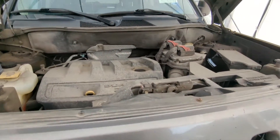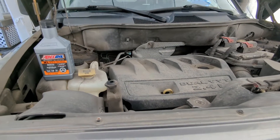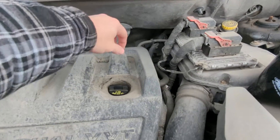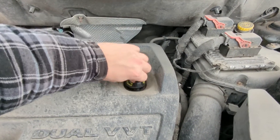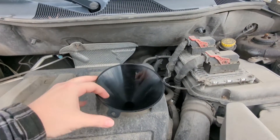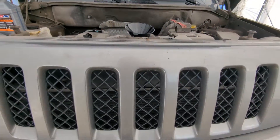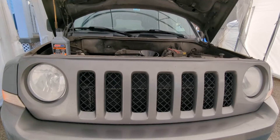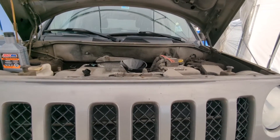As I mentioned at the beginning of the video, there's 4.5 quarts of oil. I'll be using Amsoil 5W-20. You got your fill port right here — take this off, use a little funnel, and just fill up 4.5 quarts. I got the filter on and everything, and we're good to go. And that's how you do an oil change on a 2012 Jeep Patriot with a 2.4 four-cylinder. Thanks guys.